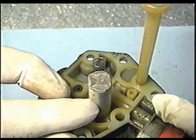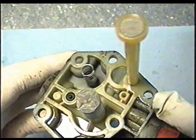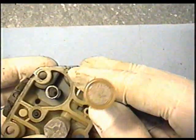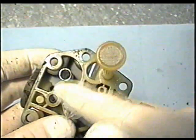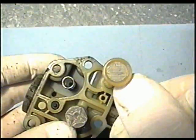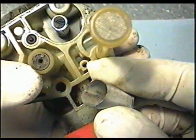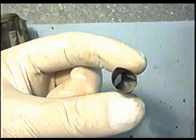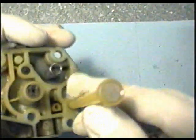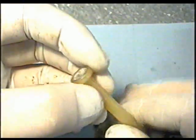You want to make sure that this little screen here is super clean. Even though it looks clean, it could have fuel trapped in it that's been varnished in there, and it could prevent the flow of fuel going through it. Also make sure that this screen here is clean as well - it could have varnished gas in it and prevent the fuel from flowing through. Now to double check this screen, you can turn it and it's going to come out. Make sure there's no water in there. Usually the dirt will be trapped on the outside - you can blow through it to make sure it's clean. If the air flows through it freely, you don't need to clean it. You can blow through here either by putting a fuel line on here or putting a clean cloth around and blowing on it yourself.